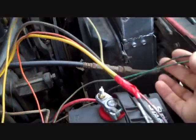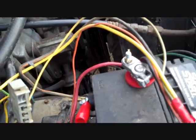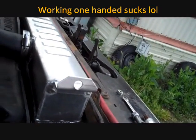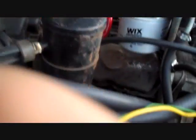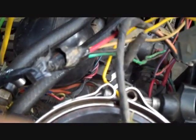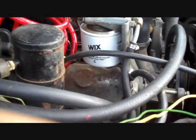If you have a tachometer like me, you'll have that wire in there too, so don't cut that. What you're going to do is take that yellow wire, find it, and cut it — it's a heavier gauge wire. You'll have to unwind those and then track the green wire from that plug-in to the regulator and cut it right at the connector. Now we should be able to take the alternator wiring harness free.